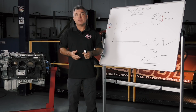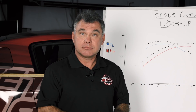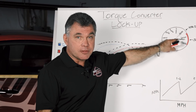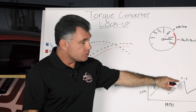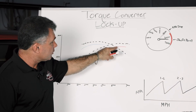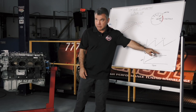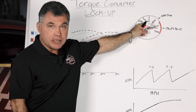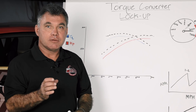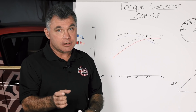What we need to do now is determine what the lockup point is going to be. Shifting too early or too late is going to slow the car down — the same way locking the converter too early or too late will. If we look at our shift points, which normally drop a thousand rpm — the one-to-two or two-to-three — we can see that shifting too early or too late causes a slowdown. That's our constant acceleration curve. Locking up the converter in that range is what we're after. There's a diamond right here — we call it a diamond for that reason. It's an optimal point of locking the converter in mile per hour, giving us a range where we're not too early or too late, perfect for efficiency.